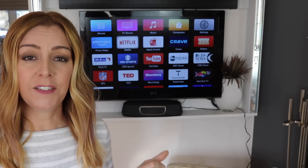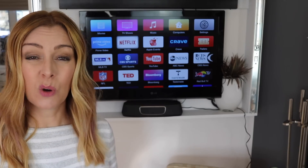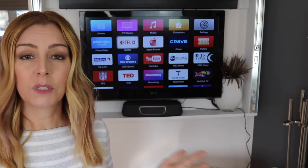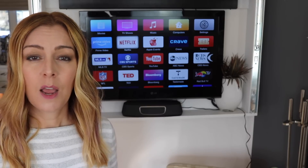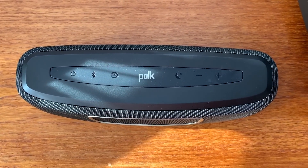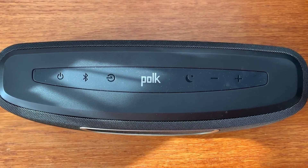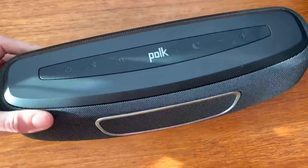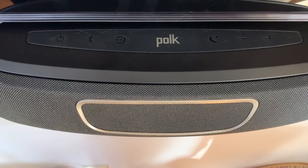When I went to play something from my Apple TV, however, there was no sound. I fiddled around with the cables, checked the volume and the power, but no dice. I tried streaming some music from my phone just to see if the audio was actually working, and the streaming worked fine, but I couldn't seem to get any sound from the TV. Perplexed, I called Polk's toll-free customer service line for help. It turns out there's a button on top — that circle with the little arrow — that switches the source into the soundbar, and you'll need to hit it a couple of times to swap between Bluetooth, AUX, or optical audio. It doesn't automatically find the output source for you. A couple clicks, and I had sound.